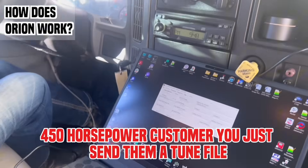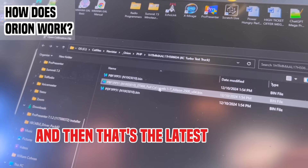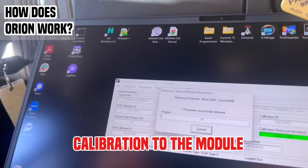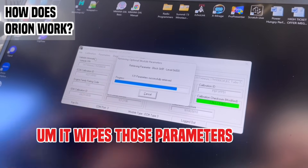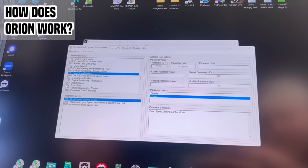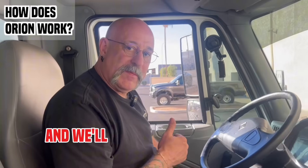Customer, you just send them a tune file — where do you go? So we go to File, Open Calibration. We'll say full cal levels one through seven. This is an Allison transmission, and that's the latest version of the calibration we have. Make sure the file is valid, then we're just going to reprogram the calibration section — write calibration to module. It reads a copy of the parameters again. Anytime it writes to the ECM, it wipes those parameters out as part of the programming routine, so we always have to write them back in when it's done. Unfortunately it is a slow process. Key on, modify the parameters — road speed limiting is enabled, vehicle speed limit is 65 miles an hour. Let's push that up to 75. We'll go ahead and put the fuses back in and we'll be ready to take it for a ride.